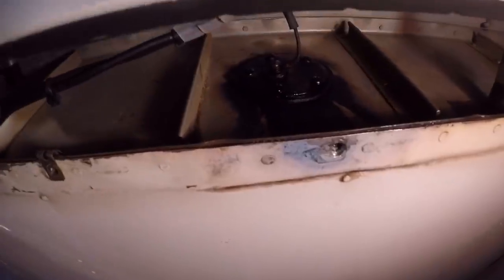Starting to pull inspection panels. I smell fuel. First thing I notice — fuel sending unit leaking. Both sides, same thing. Simple thing, just unzip the headliner. Look at the cables — extensive corrosion. I don't know if you can tell, but it's intergranular corrosion. It's deep. The part has to be replaced. No option.